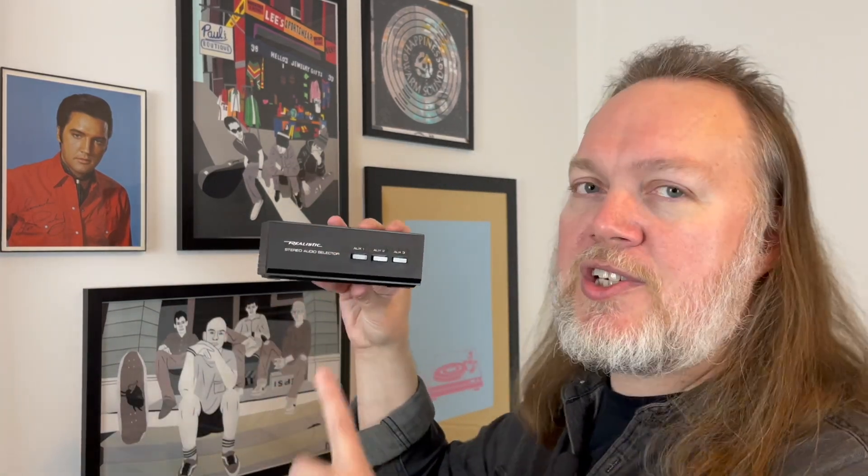This has been a fun little tool to throw into my system to add multiple sources to my Class-D amplifier. Now, as I mentioned earlier, if you're going to use one of these with a turntable, there's still a caveat — you need to make sure you have the proper phono preamp connected or switched on with your turntable to hear it properly through your Class-D amplifier. I made a video showing how to connect a turntable to a Class-D amplifier where those same connections apply — you're just connecting to the switch instead of directly to the amplifier. Click here if you're interested in watching that video.